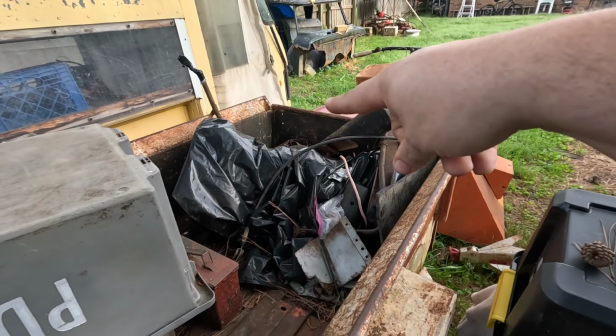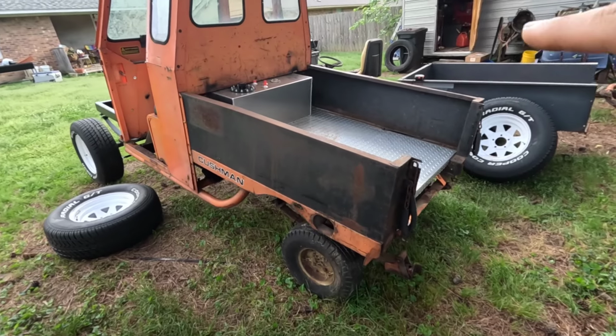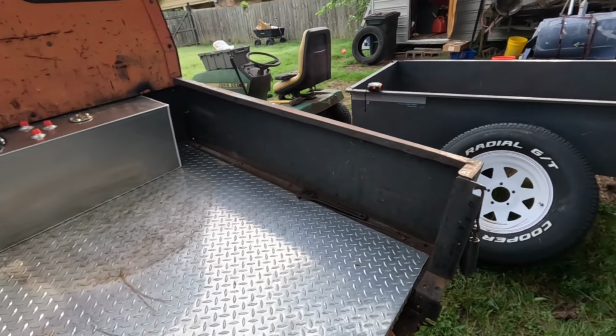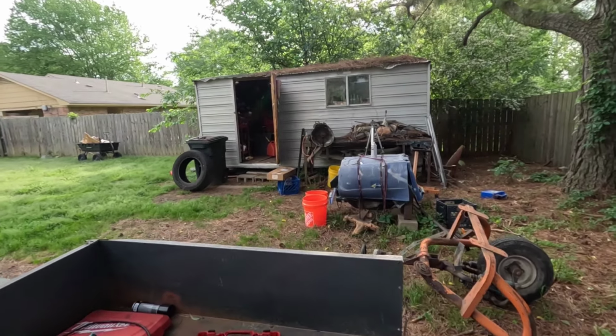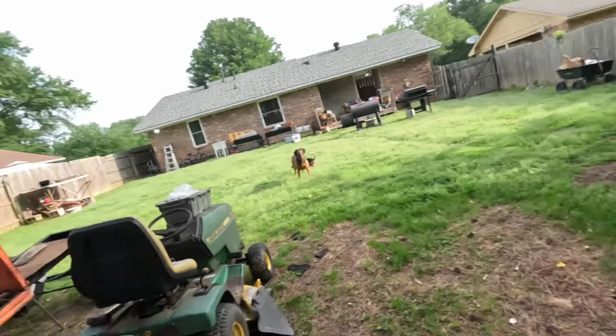So I'm going to be taking apart that one too, because I've changed to using a regular 727 big block in the Red Rocket, which I have actually already rebuilt. It's under my bench in my storage building here. If I find these four gear planetaries that I'm looking for in either of these transmissions, we'll be taking that one back apart and putting these four gear planetaries in there.